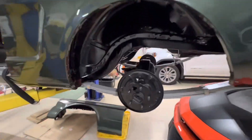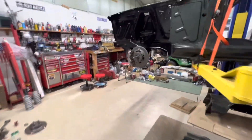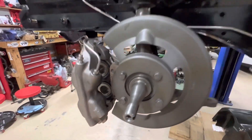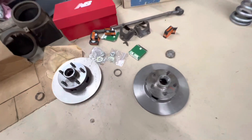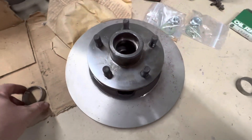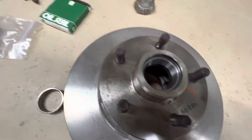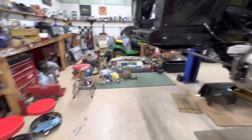Got some work done on the rear end. Got the axles installed, the backing plates put on, looks really good. Got the brake line hooked up there. Went and mocked up the front calipers, got them installed — had to do some clearancing on the dust shield on both sides, so now it clears. I was going to try to put the rotors on, but the race was installed backwards, so I pounded it out and had to buy new races for both. Put the new race inside — it looks pretty good.